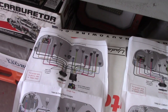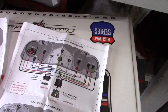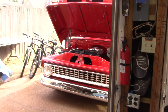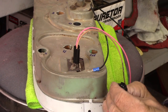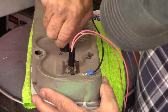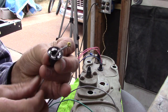I'm going to go ahead and hook up the instrument cluster. It gives me several ways to hook it up — with warning lights or with gauges. We're going to be going with the 62 to 63 configuration with warning lights, unlike my red pickup where I had gauges. These little connectors here are kind of tough to put on, but once I get them crimped up, I'll come back and put a little bead of solder on there to help it out.